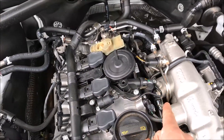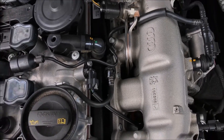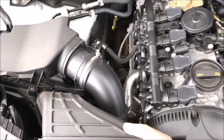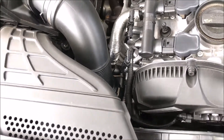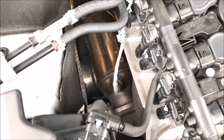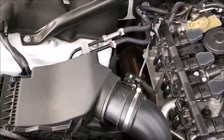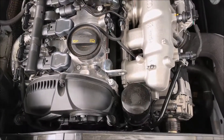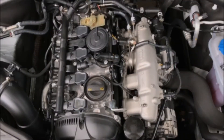Here are two lines going to another air intake system. At first I was confused wondering why this engine had two air intake systems, but I remembered this is a German-made car. This system on the left is the secondary air injection system. It connects to the exhaust manifold right before the catalytic converter — that brown cylindrical thing there is the catalytic converter with the oxygen sensor on it. It allows the air to burn cleaner as it heads out through the exhaust.